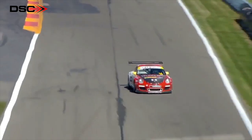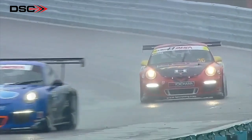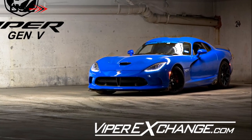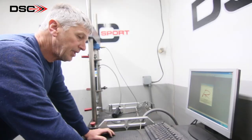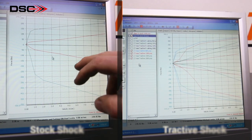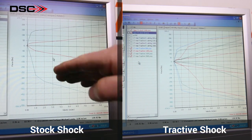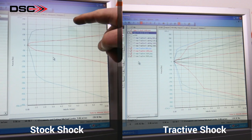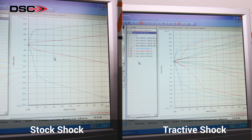We really never realized the power of the DSC until doing other cars. We started with the Viper, but since doing the Ford Focus, which has the same damper, we're able to create a different algorithm so you can have a nice riding car that handles better. And that can be achieved with a two-way shock. This will never be what the Tractive is — you'll never get multiple control configurations in real time. You'll always be stuck between two different maps, which is an obvious limitation.